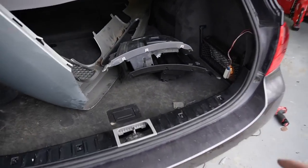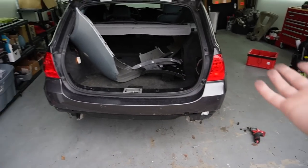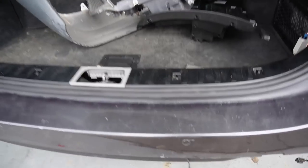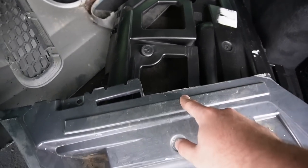As of this point, we do have both of the M3 brackets modified, the rear bumper modified, the top half modified. So now it just all needs to be combined, but we do have two more things we need to knock out, which is the crash bar we need to remove off the other E90 M3. And then on the other brackets, we need to cut off this section off the E91, so we can go ahead and plastic weld those back together.